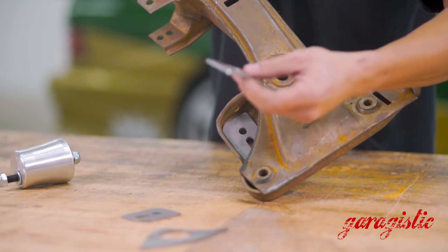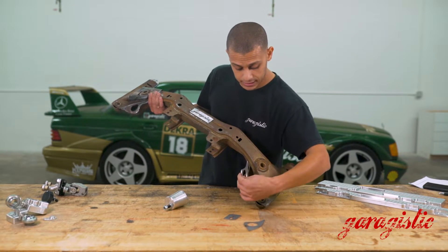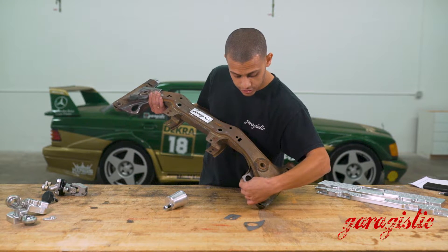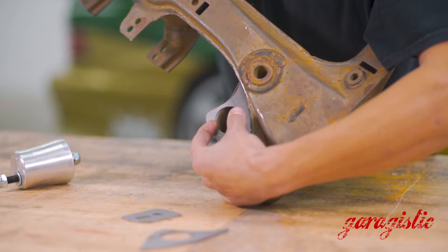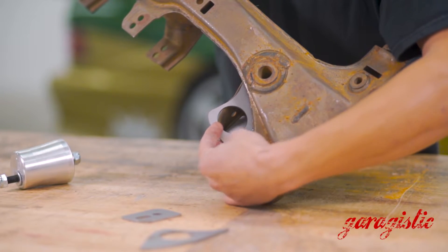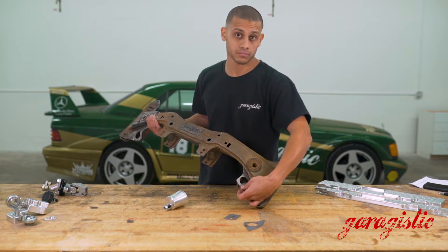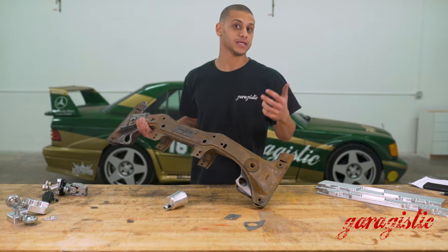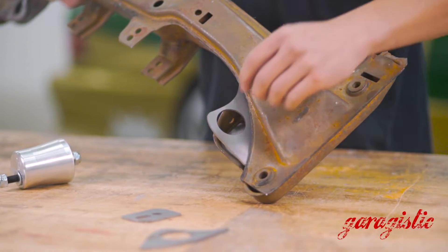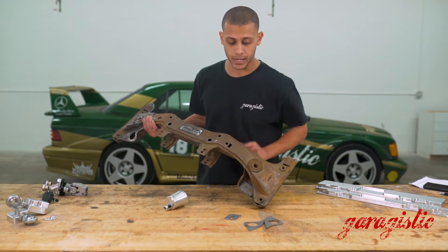You can then use our gussets. The best thing to do is to start by placing them just like that, laying a bead right through here first, and then taking a hammer and hammering this down — it hammers fairly easy once you get it going. It gives it a nice contoured edge and a nice fit. Some people just try to tuck it as well; it's up to you. Both methods work in strengthening the motor mount spot.